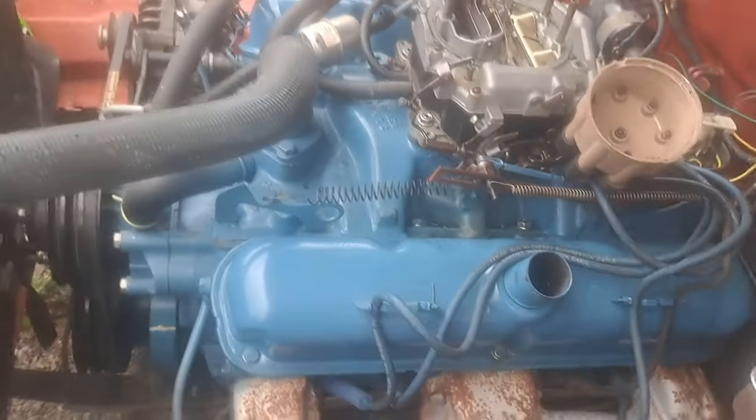And the reason for that is that it takes time for the gas and the air mixture to reach its optimal level, the perfect level of ignition. You have to mix that fuel up. It has to reach its perfect potential to fire. And by firing before the piston reaches top dead center, you're giving that air time.